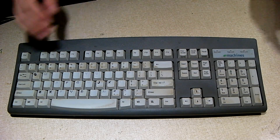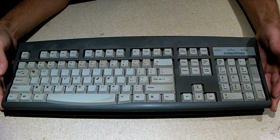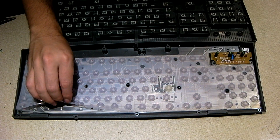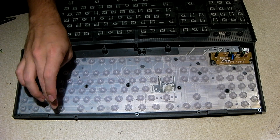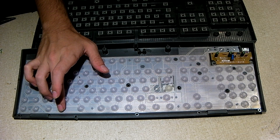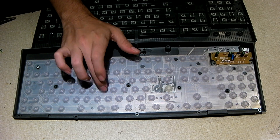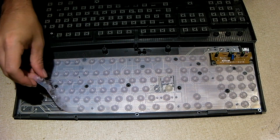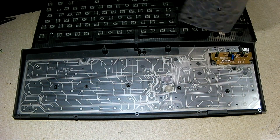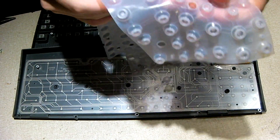Let's have a look inside this keyboard here. On top you have your actual keys. And when this comes off, inside you have, voila, your rubber domes. So right here are the rubber domes that, when you press down on a key, you get that snap. And only when you press down a certain amount, the key snaps down and it makes contact with a membrane. And this here peels right off. So these are the rubber domes that give the keys their sort of snappy feel.